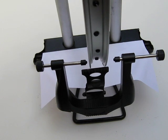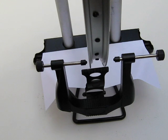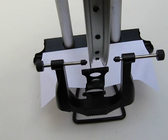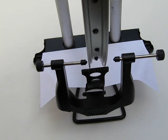The rim is going to the right. This means we have to tension the spokes that go to the left hand of the hub. We'll have a quick round to have another look. There it is. If the spoke tension is too high, you can also loosen the nipples on the right hand side. I mean, let's see.